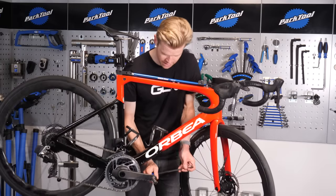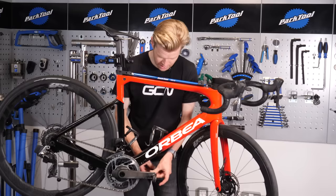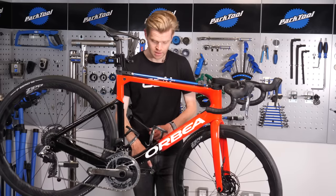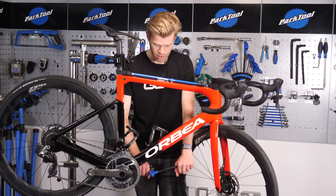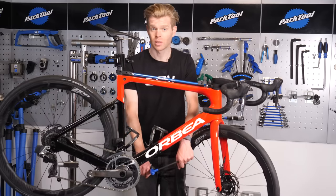You can see it's gone — I can twist it in that direction and it comes off. This is the same for both pedals. Simply put it into the forward position, then insert your Allen key or your spanner if you're doing it on the axle. Pushing down will tighten it; pulling up will undo it.